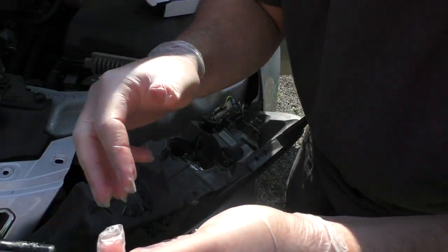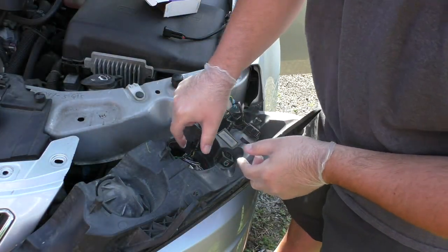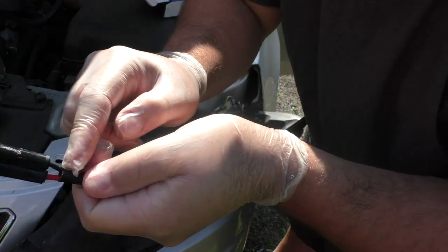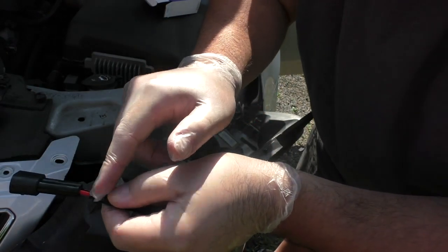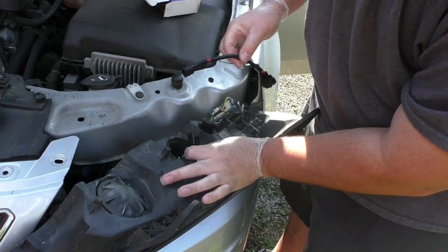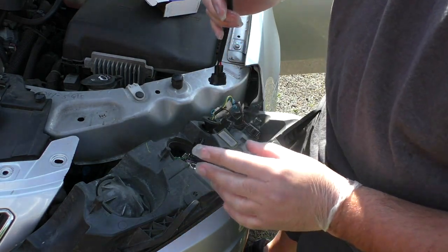You're going to cut this side, and on here you'll take these 2 black wires and wire them together, and they will go to the black wire that's inside this sleeve. The yellow wire will connect to the red one that's in this sleeve, and that'll fix it. Now that's if this thing is really jacked up.